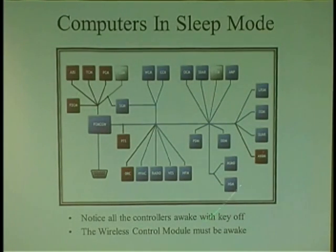By the way, this is Chrysler's scan tool, and they're the only ones out of the 20 manufacturers who actually did a really phenomenal job, because they really want you to diagnose cars. They put the whole network in a spot where I can tag any one of these icons and go right to the computer and do my diagnostics on that particular computer. And it's live information. So if I shut the key off, these guys are going to automatically go red.